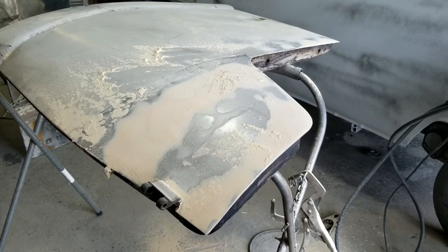Look, if your filler is taking longer than that to sand, you need to switch filler. The cheap stuff doesn't sand like that, okay? If you use the good filler, it sands 10 times as fast as the cheap stuff. The one I'm using is called AG47. Evercoat has Rage, which sands like this too. I'm using Auto Art Euro Gold, which is about $31 compared to Rage, which is $58. This stuff is just as fast sanding.